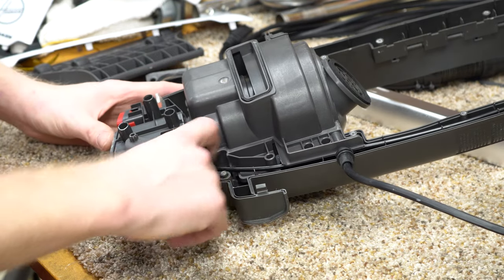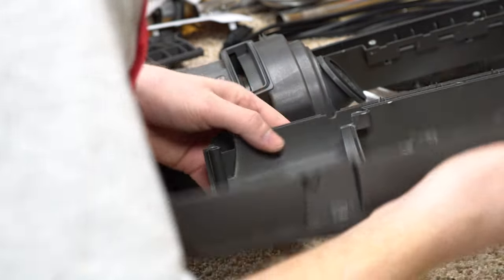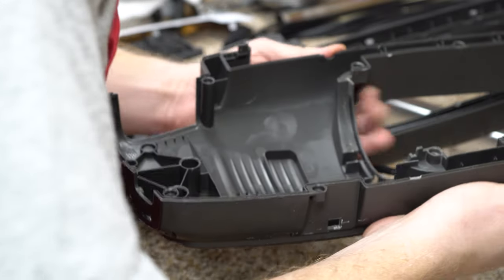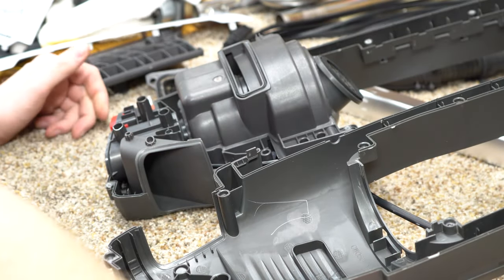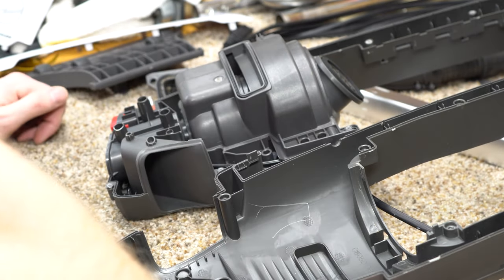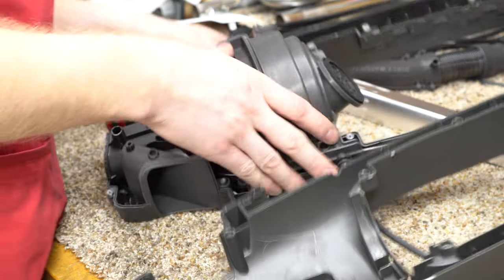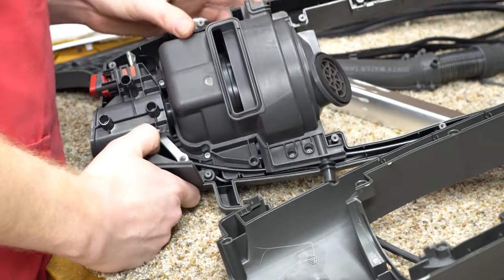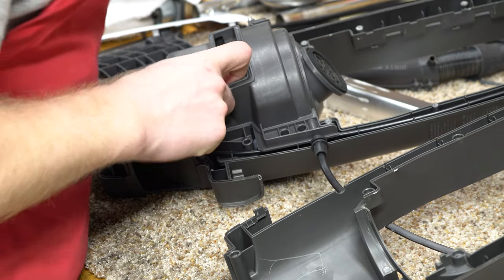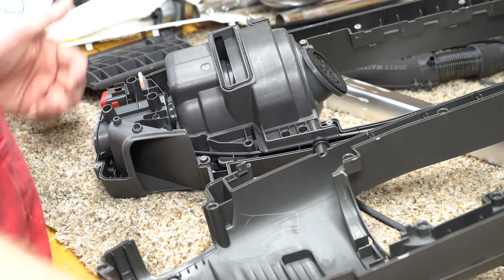There's no sound deadening — everything else is very mechanical and simple. The parts appear to be injection molded, but I'm not sure what kind of plastic they used — it's not a resin. It would be nice to see some glass-filled resin in the casing, though the motor housing does have it. But these machines are so inexpensive, it's hard to imagine them putting more money into it. The machine is a full bypass design, meaning if it sucks up water, it throws it out the side, and it cools itself with a separate fan than the one moving air — which is good for the design.